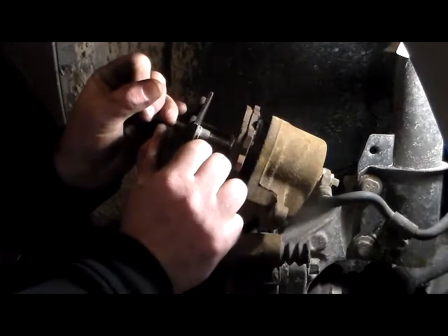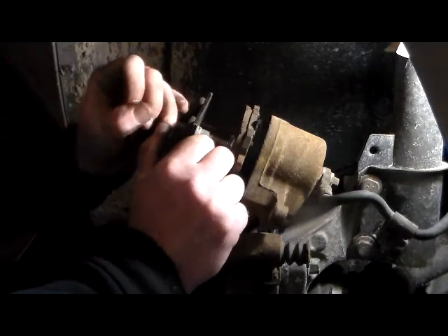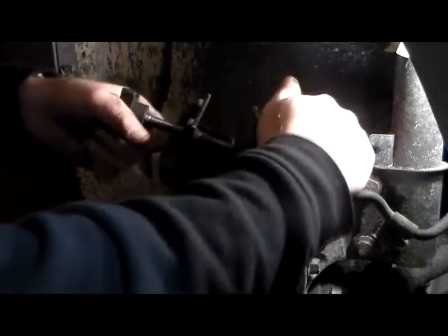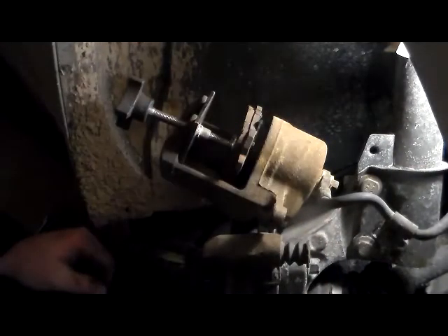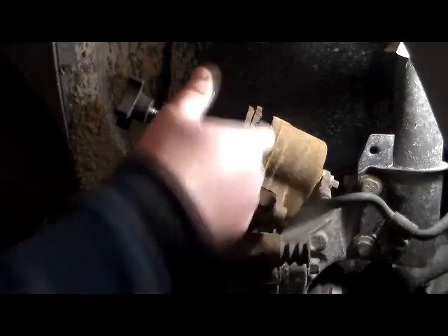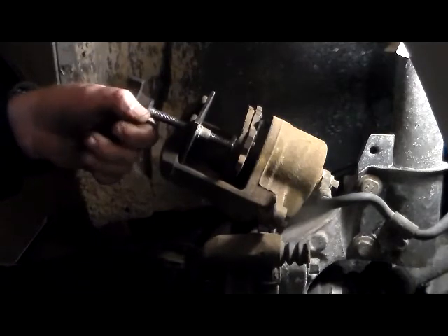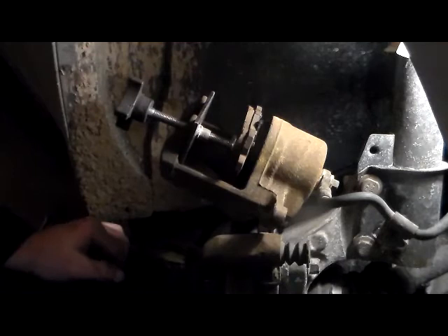The question came up here — my brake caliper is actually stuck and I'm on limited funding, so I'm just going to deal with it until the weekend when I get paid. I'll force it back in and then get it to pump back out with no problem. But once it's out, it's stuck out. More than likely there's rust buildup in there holding it. I'm going to get some channel locks for a tighter grip and crank down on this as much as I can to push this cylinder back in. I may have to go to a giant C-clamp to actually make it work.